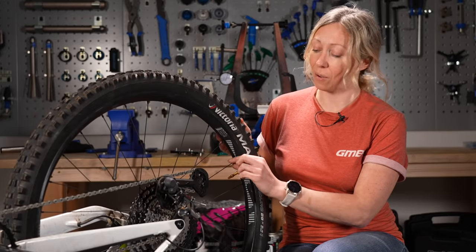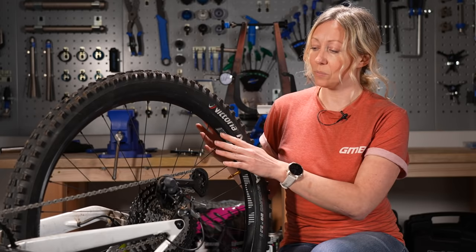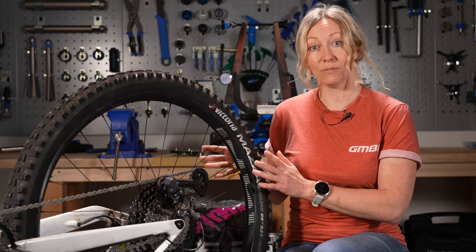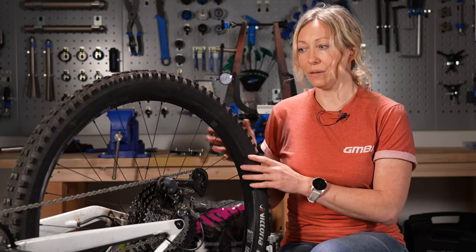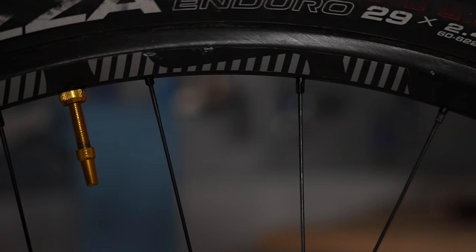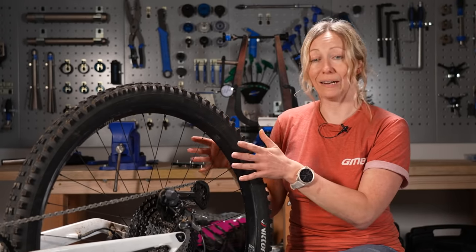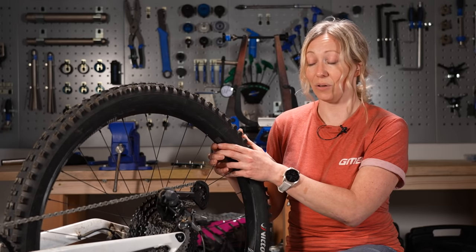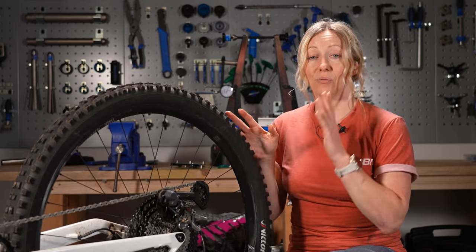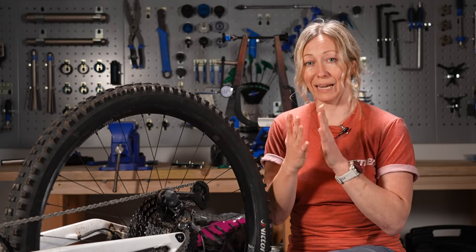Hopefully all of your nipples are back onto the spokes, everything is reasonably tightened but not over-tightened, and any broken spokes are out of the way so you can safely ride home. Roll your wheel backwards and check the clearance. Tightening up some of those spokes may have pulled it out of line, so do check the clearance. If it is really quite wonky, you might need to add a little bit more tension onto those loose spokes to get it back to straight — remember the rim favours the side of the tensioned spokes.